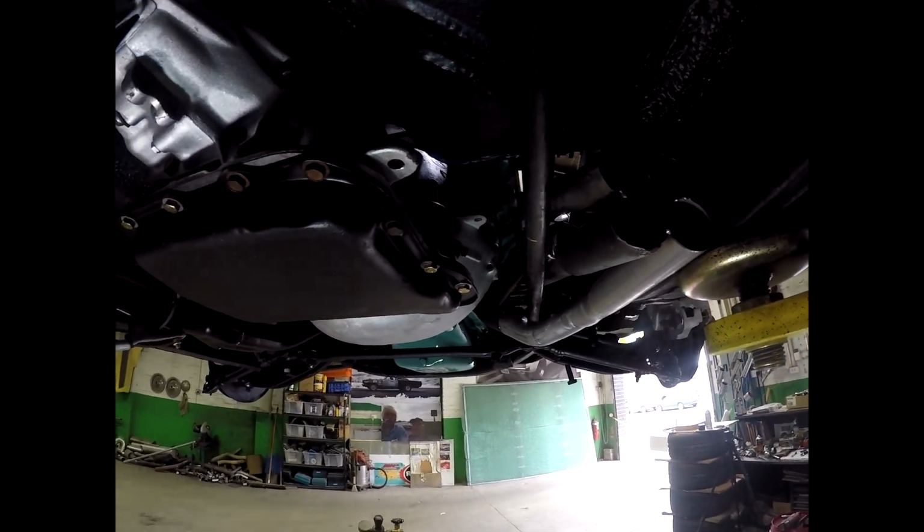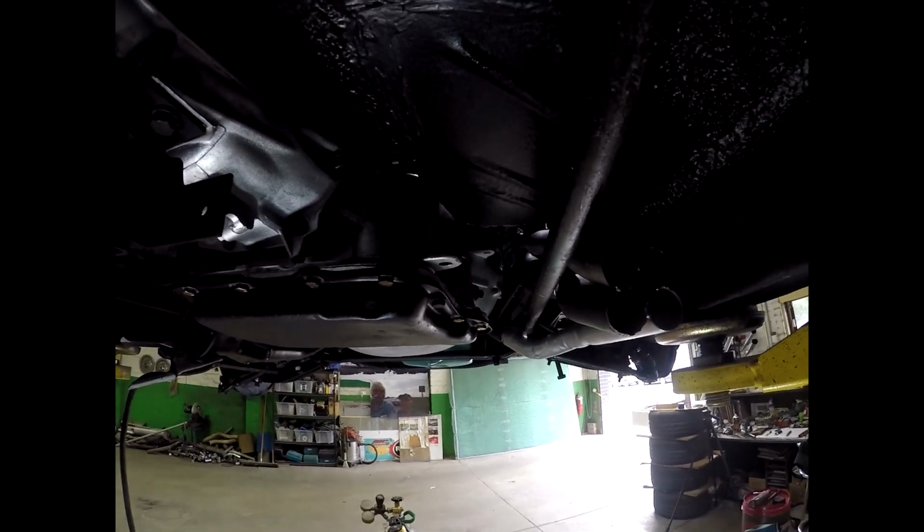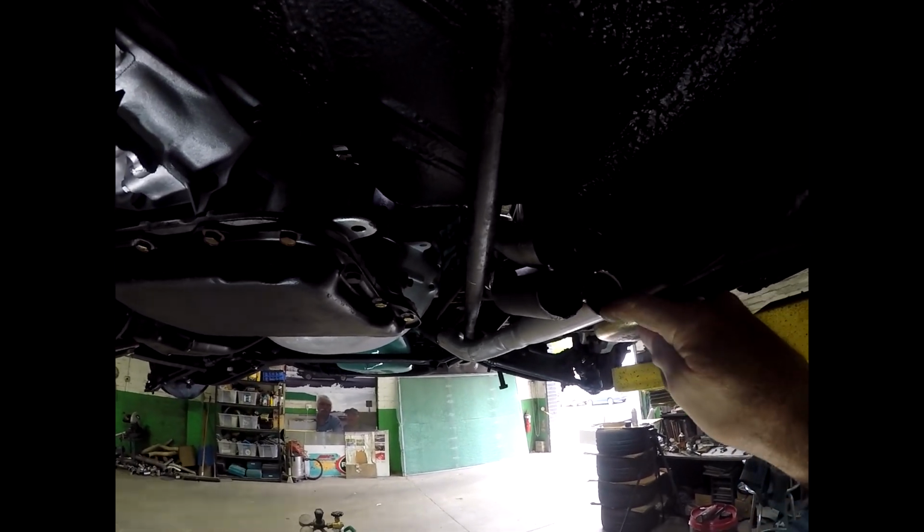But this stack around the torsion bar, it's not going to hit anything, it's not too low, it's definitely not lower than even the cross member, so it's not going to affect anything. Then you've got to put a little blank in here and weld all this in. Weld as much as you can of that up first. Then you put the collector on, and then you can weld around the outside.